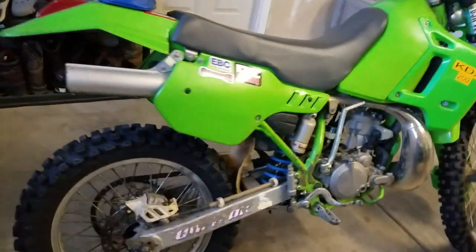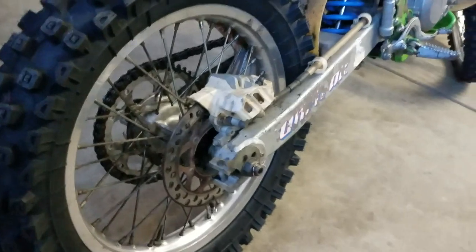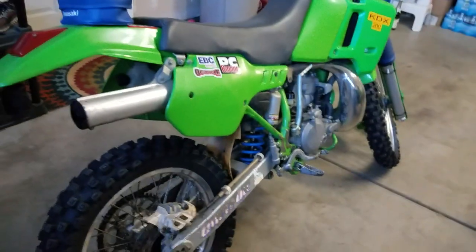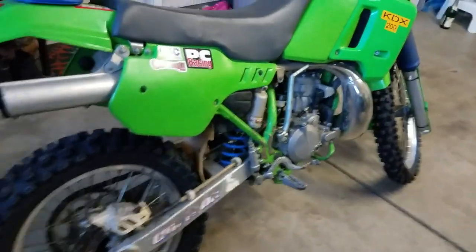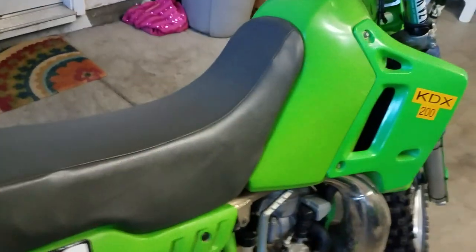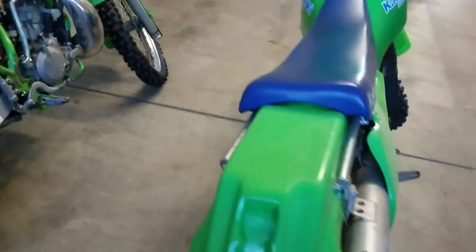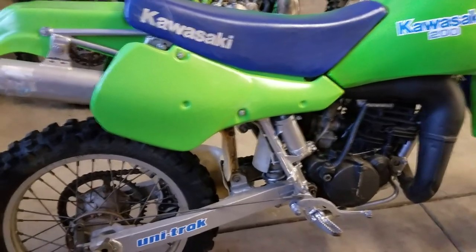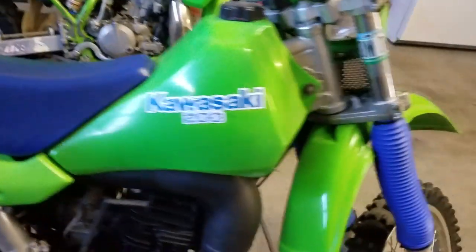I love this bike. I just put brand new Michelin Battle Cross tires on it. It has front and rear disc brakes, while the '87 just has drum brakes. Awesome little 200cc two stroke trail bikes — pretty good power for just being a 200. This '91 is like riding a Cadillac compared to the '87. The '87 needs a little suspension work — I just gotta get the rear monoshock rebuilt because the suspension is a little harsh. But that might just be the way it is — it's just an old bike with old school technology.